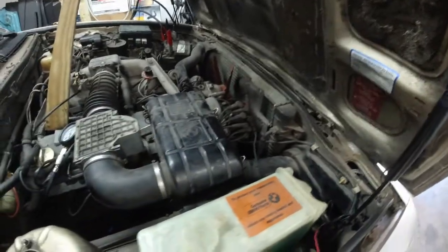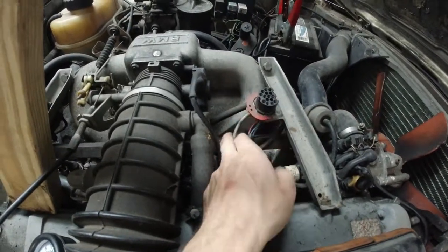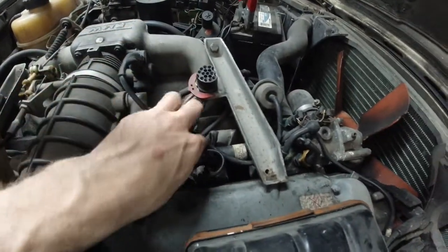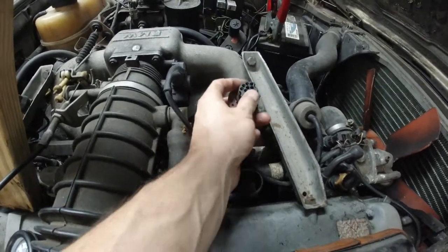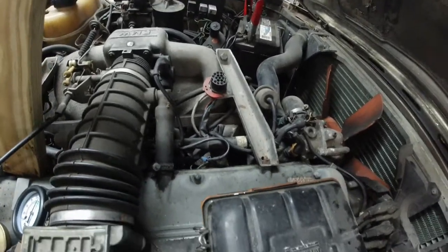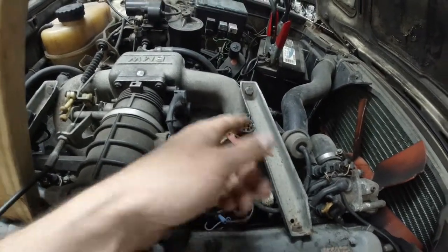It's suspicious that we're having two issues together — no fuel, no spark. I do get power at the coil but no spark straight from the coil. I would dig into the crankshaft sensor, but it's not a five-minute job. The crank sensor is wired directly into this plug with no plug in between, and I don't have any schematics. Since I don't like the way this thing cranks, I decided to do a compression test — because if the engine is shot, it doesn't matter what else the issue is.